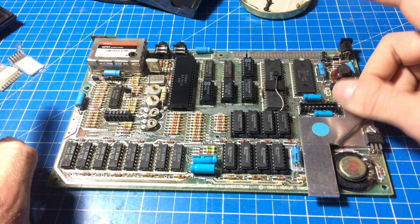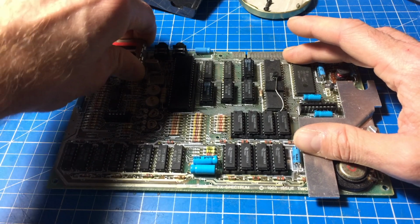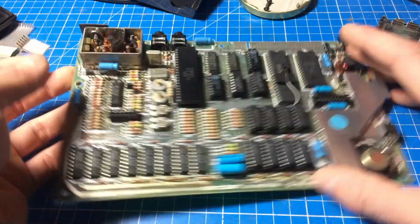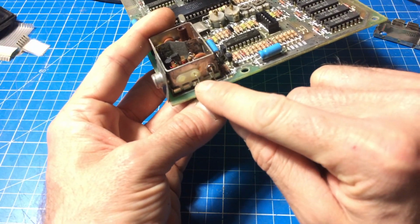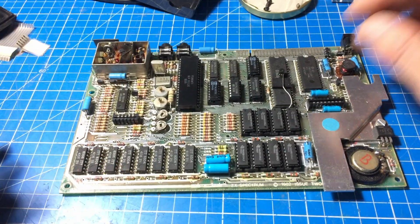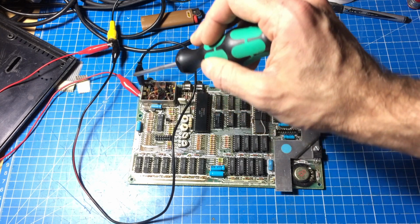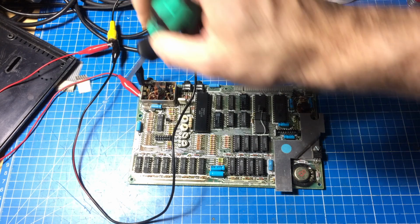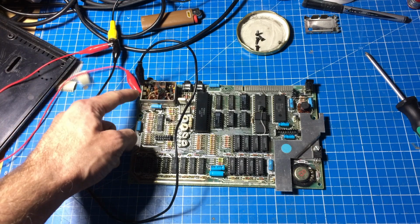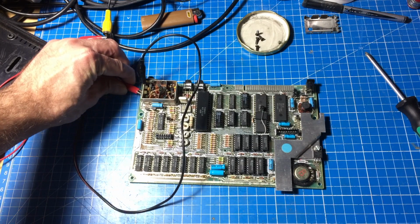What I am going to do, because I don't have an analog TV, is pop the lid off here and do my little preliminary composite mod, which is connecting the picture on this and the ground to the shielding here with some crocodile clips or alligator clips or whatever they are called around the world. Okay, here's my trademark quick composite mod. Ground goes to this and just clips on the RCA plug here, and the signal goes to the center pin of the RCA plug from the cable on the back. There's two lines going into the modulator, and one is 5 volts and the other one is the video signal.